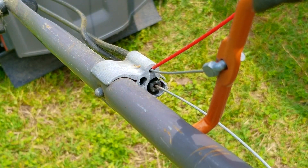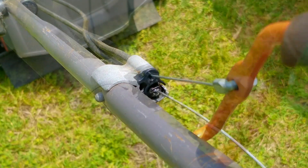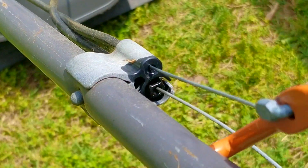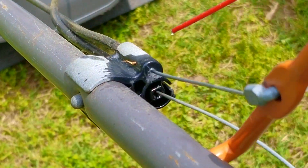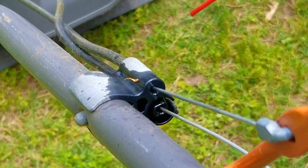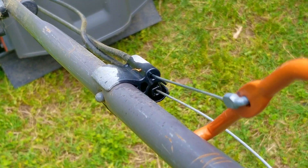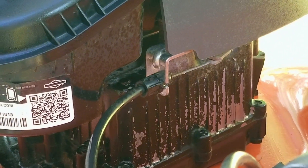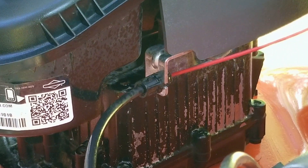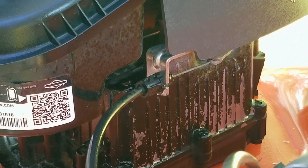To take care of these cables, I'm going to spray some lube into them and work the cables. If left alone, the cables could break, which would cause your mower to be down for a couple days while you wait for new cables. The other reason you want to take care of these is because the cost of cables isn't getting any cheaper, so you want the ones you have to stay working for as long as you can. I'm also going to lubricate the other end of the cable as well, but the upper part is the most important one to take care of. After doing this, the cable is working a lot smoother and should last another season.